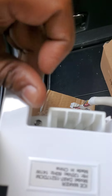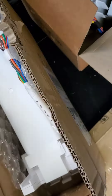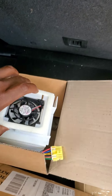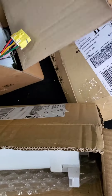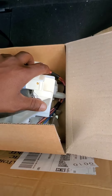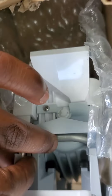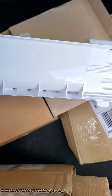This is the heater right here on the ice maker. This ice maker has a cover, and when we install it, this ice maker slides over an evaporative coil. What happens is the evaporator freezes the water inside the ice maker. There's a fan on the assembly that works along with the ice maker to freeze the water inside the tray. Whenever it gets cold enough in there, the ice room sensor will let the ice room know it's cold enough to go into harvest, and the heater will kick the ice out of the tray.